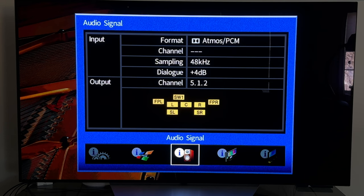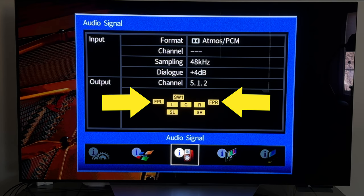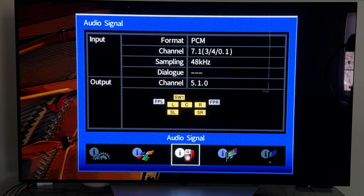What I thought I would do is show you some of the statistics screens that my receiver reports when things are getting passed over to it. A little bit earlier I booted up The Mandalorian on Disney Plus to show you what it looks like when using a streaming service, and you can see my receiver picked up the Atmos tag — it was properly getting the audio coded that way even though it was LPCM coming over, and it enabled my two upward firing speakers. But when you run a 4K Blu-ray file with an embedded lossless Dolby TrueHD Atmos soundtrack, my receiver is not picking up the Atmos tag, the two upward firing speakers are not activating, and all it's seeing is 7.1 channel PCM.